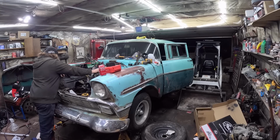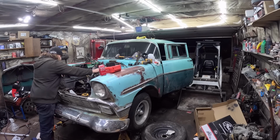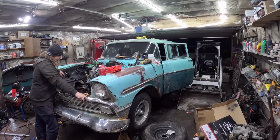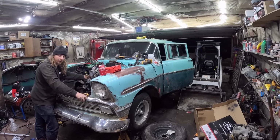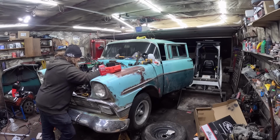Okay, well, it runs, has fuel pressure, obviously does its thing, but I don't know how it could crank to 4,000 RPM with the intake closed unless I have a vacuum leak, which may be possible. Motor was quiet, didn't make any noise. When it instantly fired, instantly 4,000 RPM, that's where I'm leaving it. It runs.